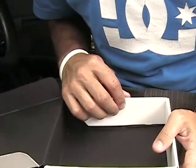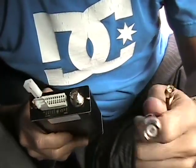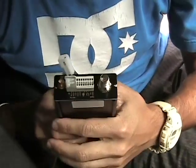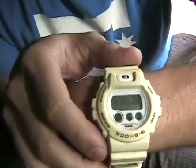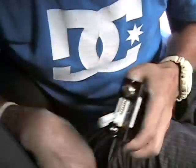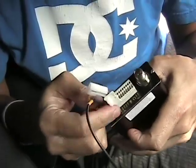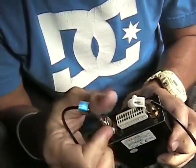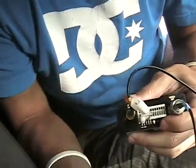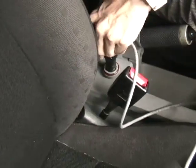Let's ditch the guide for now and I'll serve as your installation guide for today. We'll go through the cigarette lighter install — starting with the device, the antenna, and both connectors. We'll place the antenna on the dash so it can have a clear view of the sky. The device is upside down but you can see we're at all zeros. We'll go ahead and install the GPS antenna, then the GSM or cellular antenna, and then connect the cigarette lighter power.